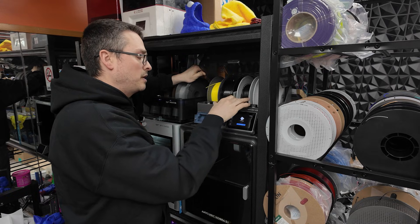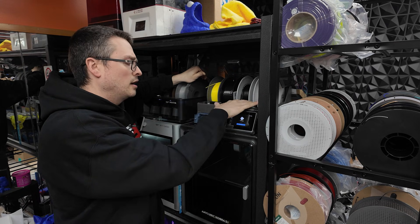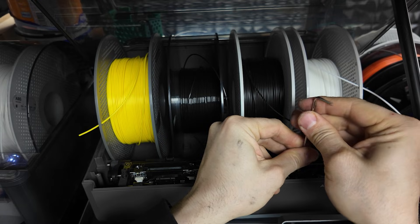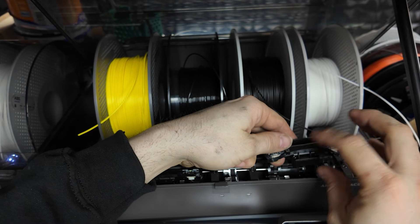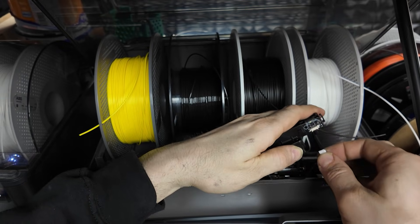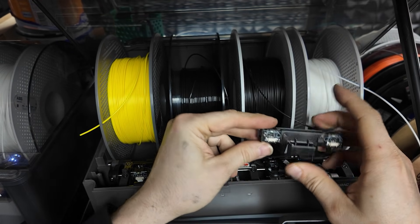Next, we're going to be removing our rails. I'm going to go ahead and remove this side first. This side is still working, so I'm not going to mess with it right now, but we'll get that side removed. Using that same Allen key, there are two screws right in the front that have to be removed. Once those screws are removed, you can just lift this right out — you'll see there are two wires here that connect to the actual sensors. You're just going to disconnect those and then fish the wires through the wire clips on the side. We'll pull this out and go over to the bench.